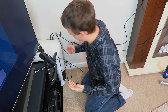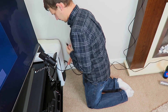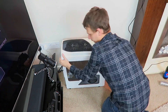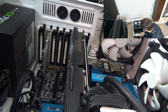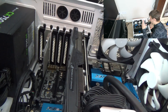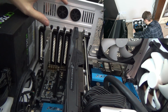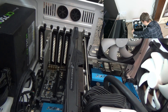Step one of installing any hardware is to turn off the system. Now, if you've never opened up your machine before, one tip is to always be ESD protected. You can get wrist straps or ankle straps that will prevent any static discharge from damaging your board. If you don't have those, in a pinch you can connect the power supply to the main socket with the power supply turned off — that will also give you some static protection.